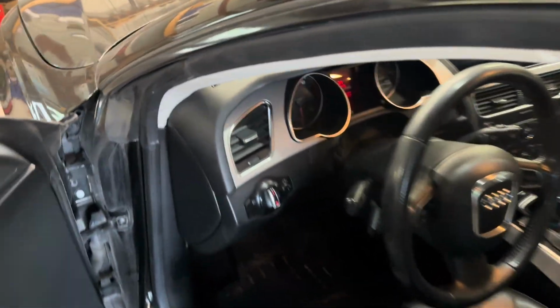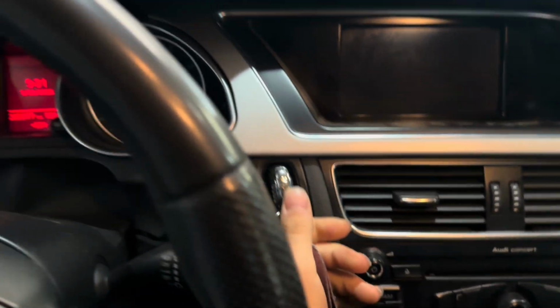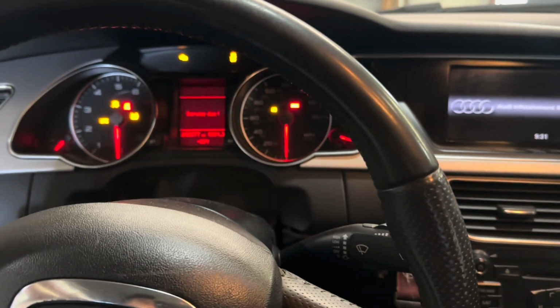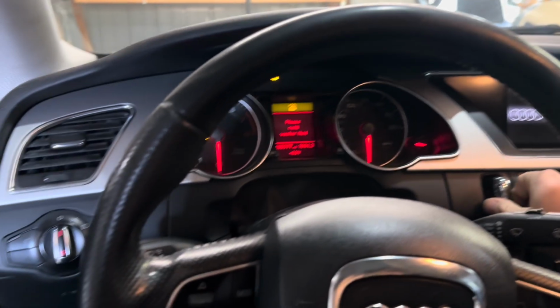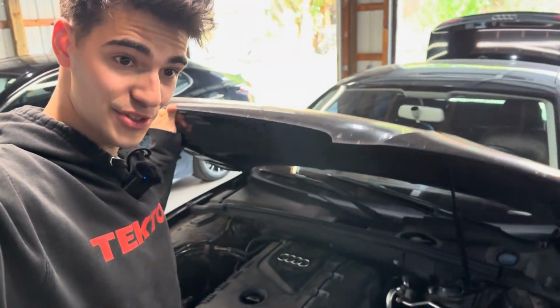I was just a thirsty boy at the store getting something to drink, and when I came out she would not start. Watch it start right now. Nope, still nothing. But I don't know if you can hear it clicking. I had already replaced the battery and the alternator on this thing before, so I didn't think it was gonna be either of those. So, push started it, drove it home, and here she sits.